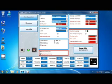Well, this function is used in all those vehicles that in cold start are sending a set of pulses to the ignition coils, causing a wrong RPM readout to be shown. So when enabled, the ECU will automatically filter the pulses in excess.